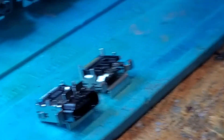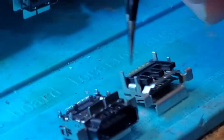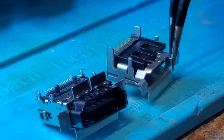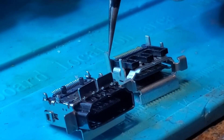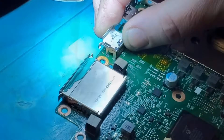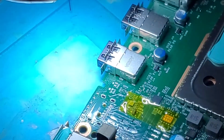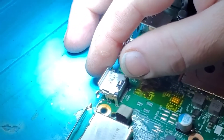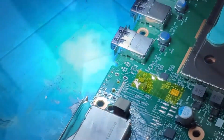Here are the differences — you can see this replacement port is definitely a little bit shorter, and there's plastic on the bottom. We're going to have to modify the posts on here a little bit, trim them down so they line up in the holes. I'm going to trim these front ones down a little bit so that it sticks forward a little more and the pads line up — we're going to do that with a Dremel.